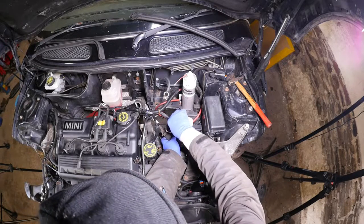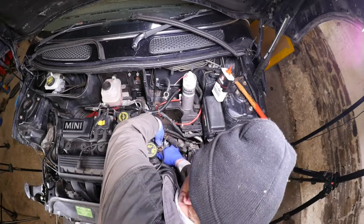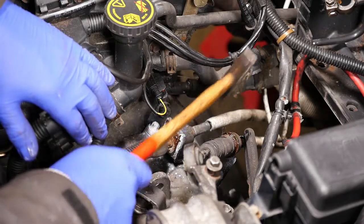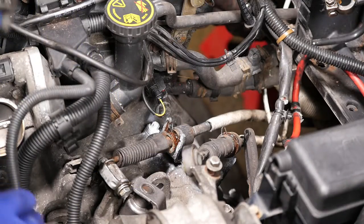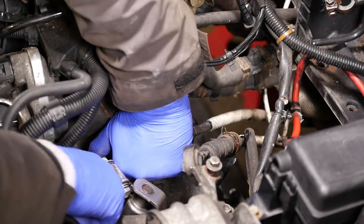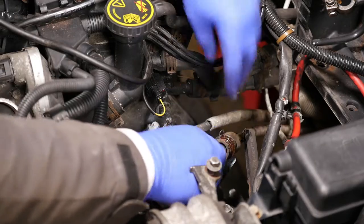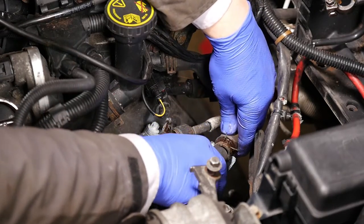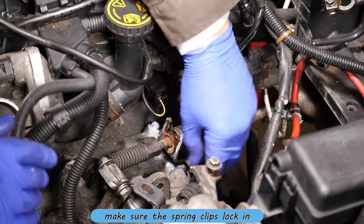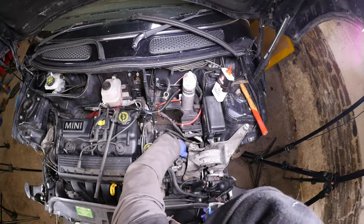Adding a little bit of three-in-one there to try and help, as I need to rotate it. It's in but not quite — it is going up and down, so I've got some movement now. I just need to try and push it in fully and get those little spring clips to clip into the cutouts on the side. Pop the ball joint on there and get that one on. This one went in a little bit easier — there it is, sprung in quite nicely. Make sure they're in, otherwise they could pop off while you're driving and you'd lose your gear change.